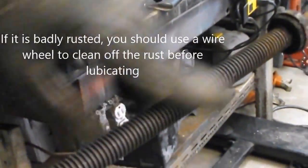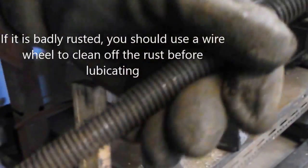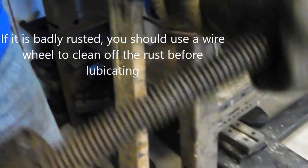So now what you're faced with is this — and you could imagine it would be a big threaded rod. What happens is this rod gets corroded, and the nut that it screws into also gets corroded, and the lubrication either goes away or wears out. So what I'm going to do is heavily grease this, and then it will spin nicely inside of that nut.